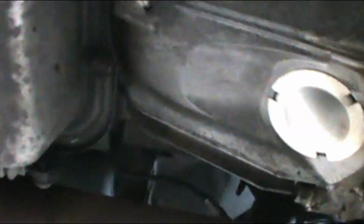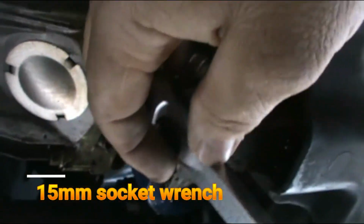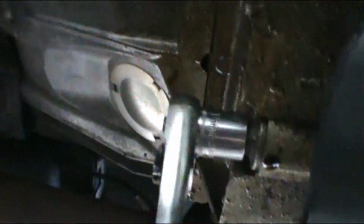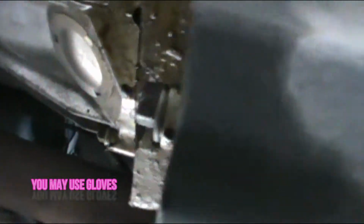While on it, make sure this thing is tight and sealed. It is. So we're gonna take the bolt out, and the one for the oil calls for a 15 millimeter. It shouldn't be that tight. Make sure you put the pan in place, and sorry about the camera confusion, and we're just gonna get it loose. The way I do it is that I get it completely loose, and I actually do it by hand. I don't know if you want to do it or not, because it's a little bit hot. I'm already used to it.